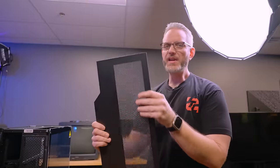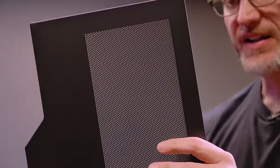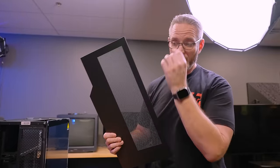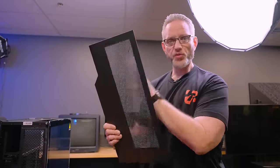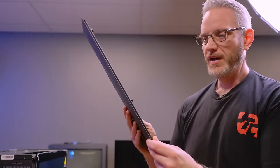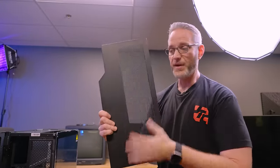In terms of mesh material, it's going to be a little obstructive, so you're gonna keep that in mind. I would have liked this to have been larger mesh just to allow a little bit more airflow. It's pretty fine mesh, so the fact that there's a lot of fans in here are going to be needed to overcome the restriction in this mesh. But part of the reason for that is the fine mesh is also working as the filter itself — it's doing double duty. Case manufacturers will often put big openings and then really restrictive filters; the difference is you can remove those filters for more airflow at the trade off of more dust intrusion. In this case, it's just the mesh material, about two millimeters of opening.